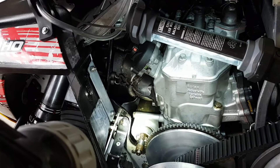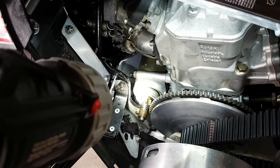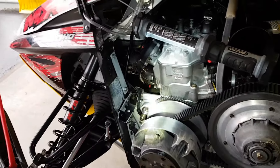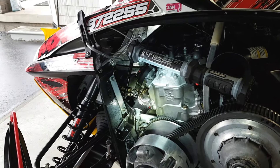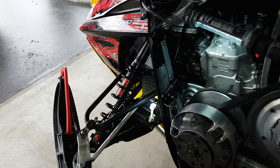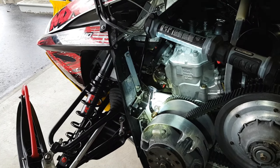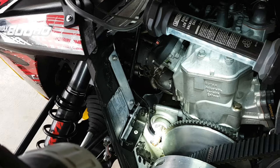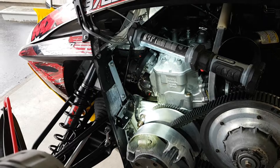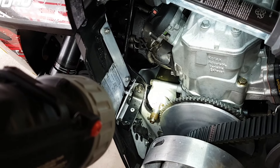If you have an electric start, the first issue is a silly spring. This is a spring that's already been replaced. I bought a brand new starter and right from the very beginning it seemed to have some issues. I noticed a ting-ting-ting sound and I thought it was the front muffler, maybe springs, something rubbing on the tin, or a suspension component because I could really hear it going over bumps. I couldn't figure out what it was. Then one day I put it in reverse and I thought the engine was blowing — I had no idea. But as it turns out, it was just the Bendix hitting the primary clutch.